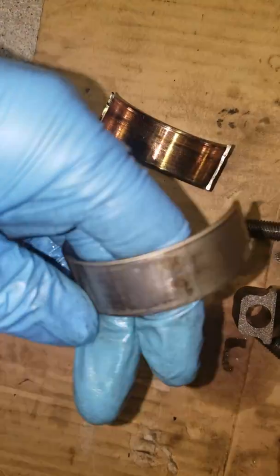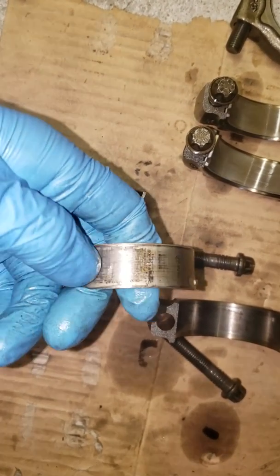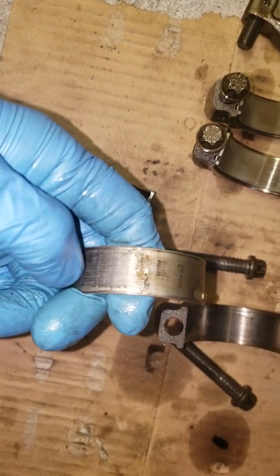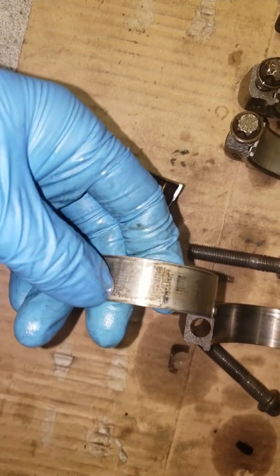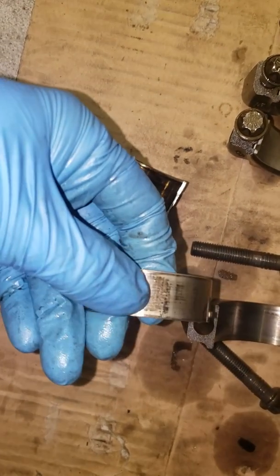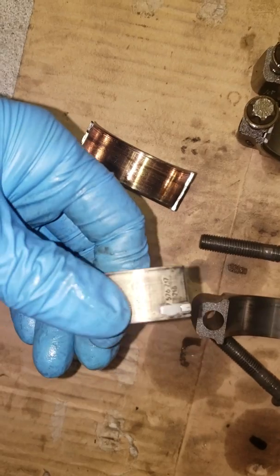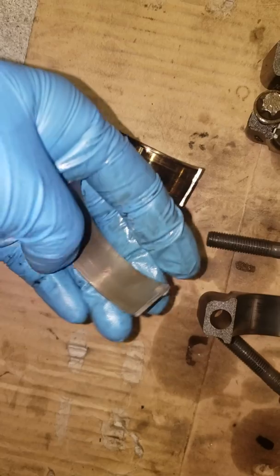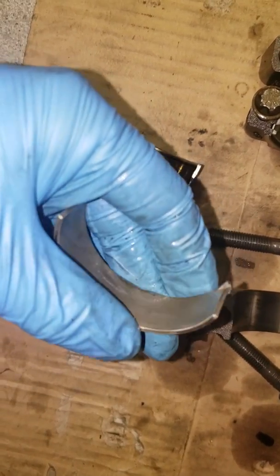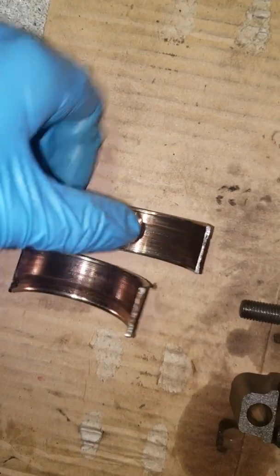Here's the number six bearing for comparison's sake. You can see this one also looks like it's got a lot of wear on the back side of the bearing dead center — this is the cap side. The rod side or upper bearing usually takes more of a beating, but you can see these lower bearings have a lot of wear dead center on the bottoms. This is a JB4 car. I think the owner probably ran it on map 7 on regular 93 octane. The car was probably knocking quite a bit.